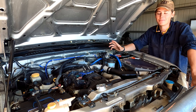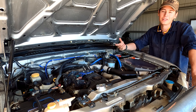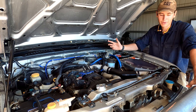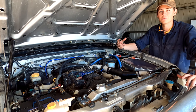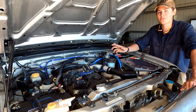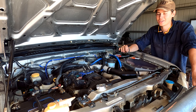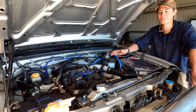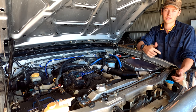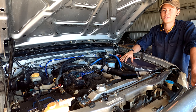Next best mod is an intercooler. I'm thinking more in terms of reliability - if your turbo lets go and throws the impeller into the engine, an intercooler will catch that and save you an engine rebuild, so it almost pays for itself. An intercooler cools your boosted air after the turbo, makes it more dense, lowers EGTs, and they look sick. For ZD30s you can grab one off a Patrol if you want cheaper. I picked up an HPD intercooler secondhand for around $600 - otherwise they're $1,500. The ZD30 guys can also use an XR6 Falcon intercooler with a front mount since both the intake and outlet are on the same side.